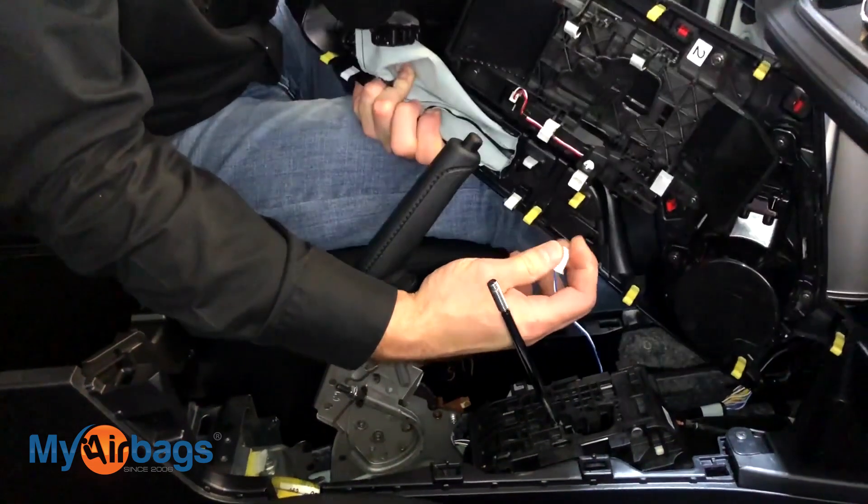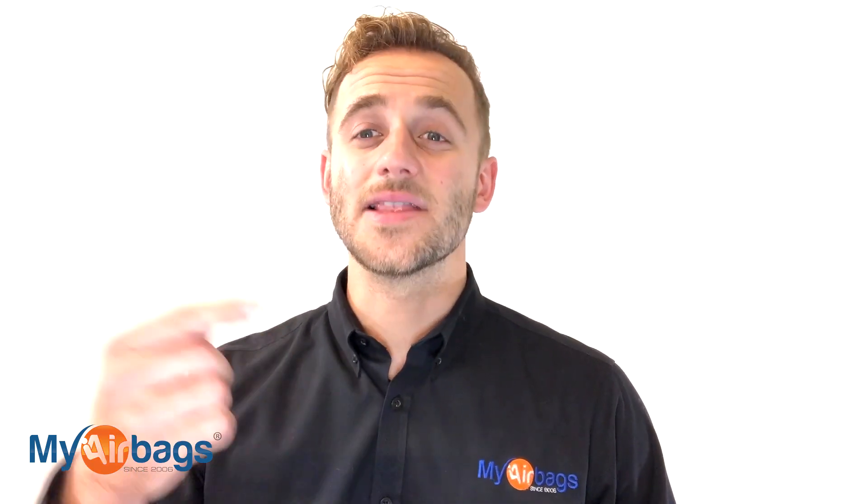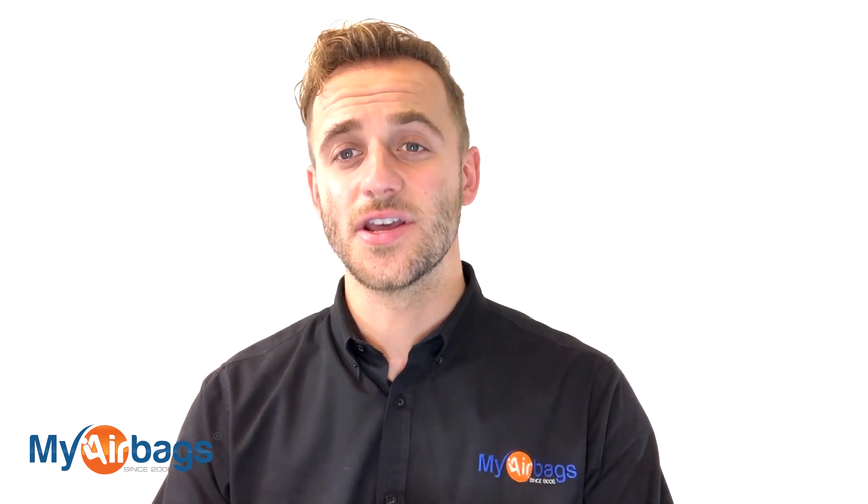Here's what you need to know: when the car gets into an accident, there are three main things that could be causing the airbag light to be on — the airbags, the airbag computer module, and the seat belts. Any deployed airbags must be replaced with new airbags. You can buy a new airbag module, but the problem is they cost up to a few hundred dollars, plus you have to pay a dealership technician to program it to your car — in other words, you have to marry the new unit to your car.